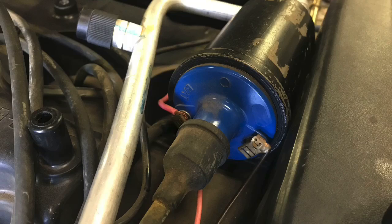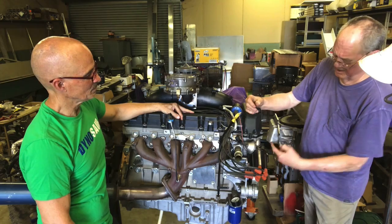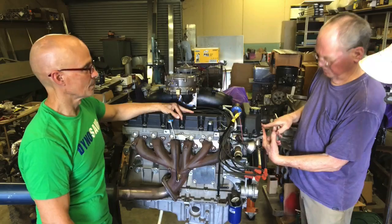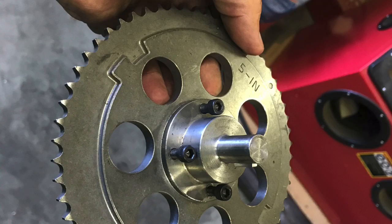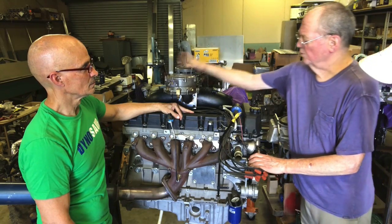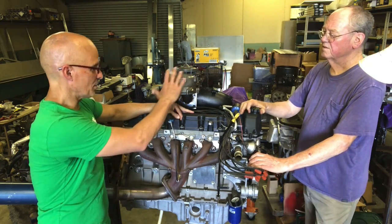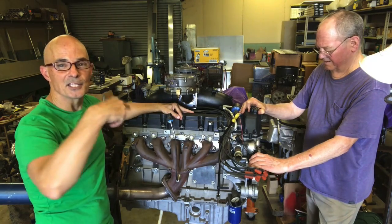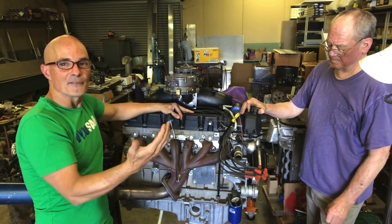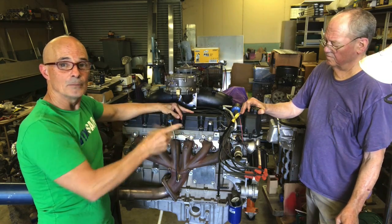All you had to do was hook up the coil wire and provide 12 volts. I had to fabricate a drive for it. There's a sensor that goes to the cam, and since I wasn't going to use the phaser because I didn't have the computer to control it, I simply put a gear on the end of the cam and one on the distributor — it's a right-angle drive. I found top dead center, zeroed it up, and then went to the propane carburetor because I didn't want to run wet fuel. With the fuel injection gone and no controller, you've got a carburetor, so you've got to have a distributor with it.